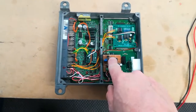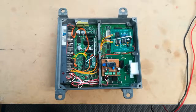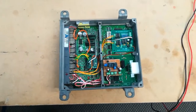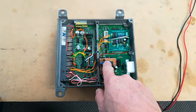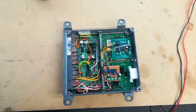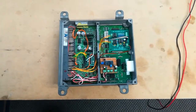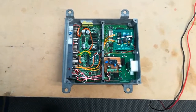So this is going to give us even more power than you saw from the current videos, where I was getting an easy 20 plus kilowatts. This will fix the V-pin voltage and the BCM voltage at 120 volts, which is basically the minimum the car will allow for maximum power. The car will think it's 120 volts when this is activated. It's activated via the IMA CNC with a special data code coming from the OBD2 when you put your foot down. So this will then switch this. The voltage will be fixed at 120 and the current will rise by another 30 or 40 amps or so, which will give us another 5 or 6 kilowatts. So that'll be about as absolute maximum that I can expect from the system.